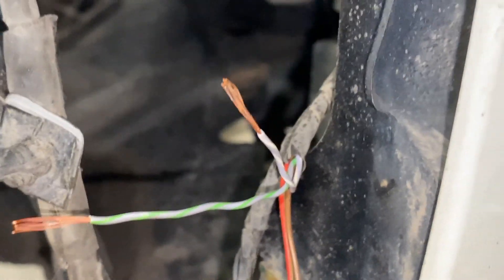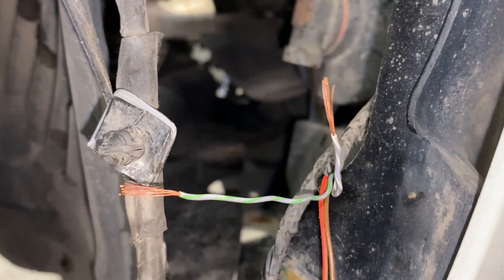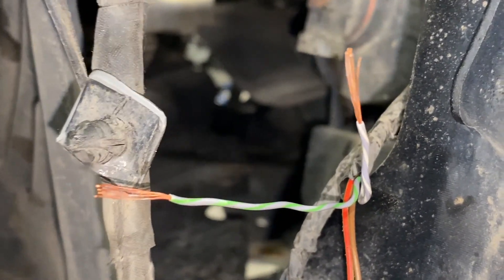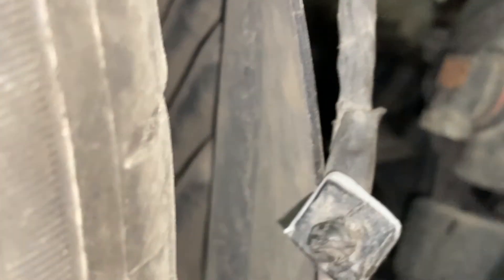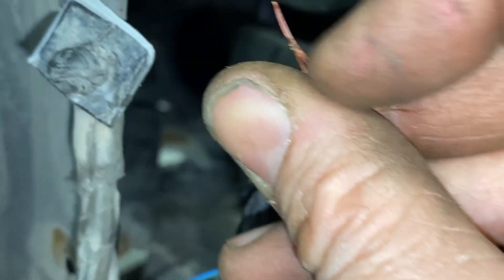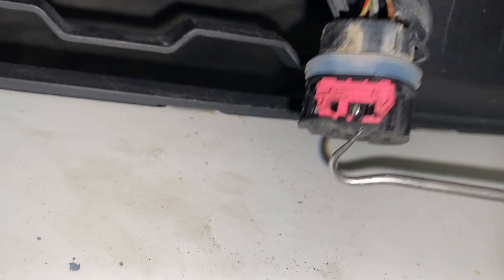I'm not happy with how absolutely oxidized and corroded it is, so I'm going to replace the S-CAN wiring from the ACC up to this point. A bit more work, but we're not going to mess around — it'll only come back if I don't replace those wires. They're absolutely oxidized. To the trained eye they're dry; there's no strength to them. This one is absolutely gone — it's like powder. They don't pass the Johnson test.